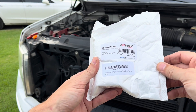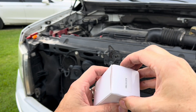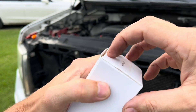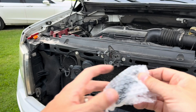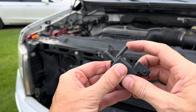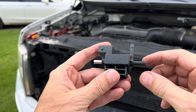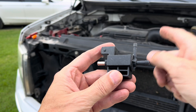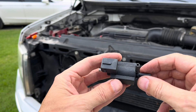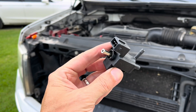So here's our replacement part, picked it up off Amazon. I think it was $23 and some change. There's a part number if you can see that — it's identical to our part. This is the nipple that's broken off on our factory part, and I believe this is what may be letting that vacuum leak get worse. I've actually glued the factory one and held it in place — I don't know that it's going to work very well. But this new part came in, so now we're going to install it. This is incredibly easy to replace.